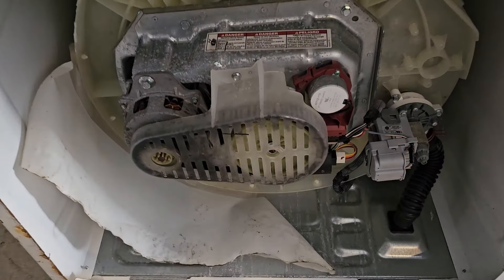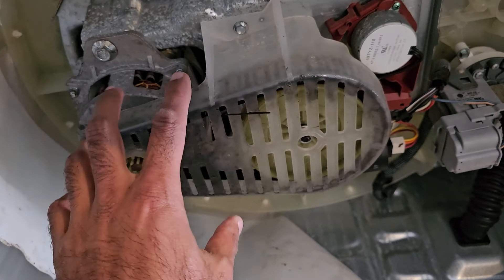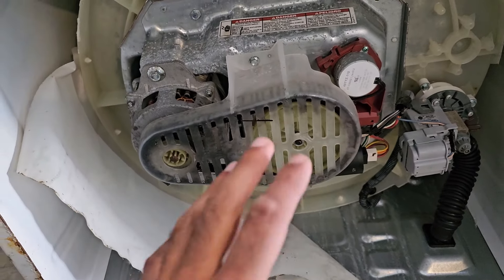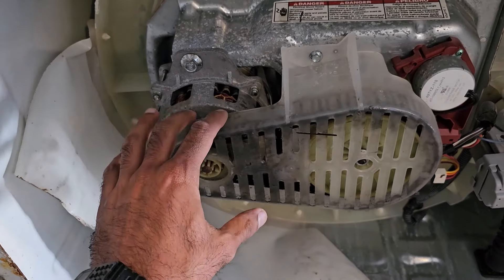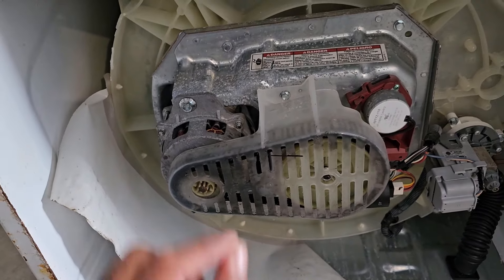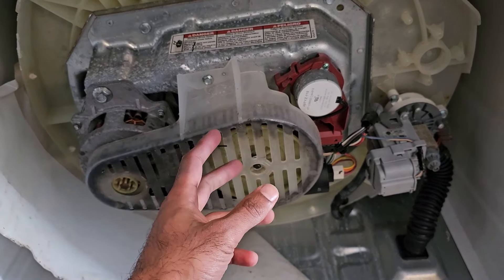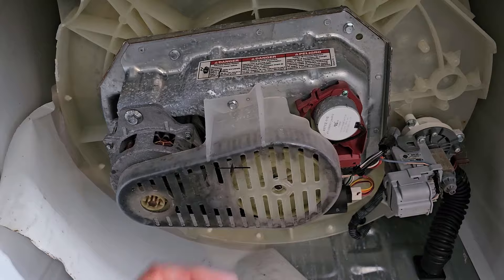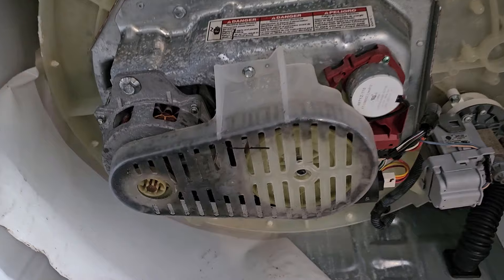If you're watching this video, this is what your washing machine looks like — you put it on its back and you've discovered that the belt cover is just completely covered in oil and grease. Well, most likely that's coming from a leak in the transmission. There are motor bearings that can also leak oil, but I've already disassembled this motor and inspected those bearings. In this video I'm going to show you how to drain out whatever remaining oil is in there and then fill it up with a heavier grease that's going to be too heavy to leak past the nylon seal that's leaking.